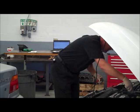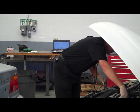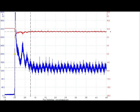I've placed my high amp clamp on the battery negative cable, but since current is the same everywhere in the circuit, you can place it on either one. Just reverse the clamp if your pattern is upside down on your scope screen. Now start your scope trace and crank the engine over with the throttle held wide open, just as you would normally.